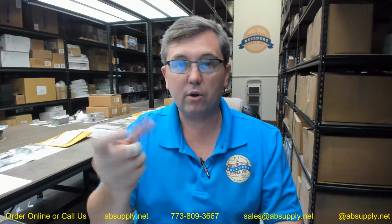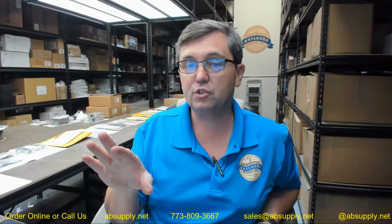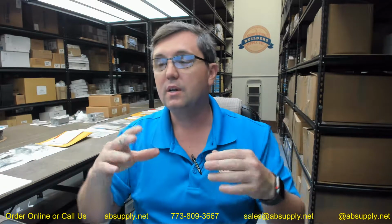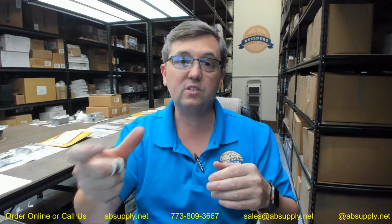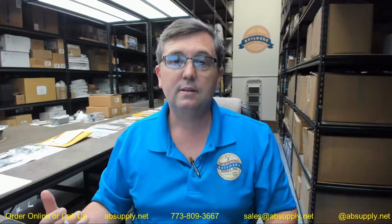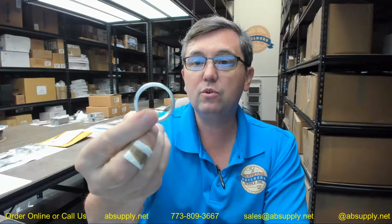The reason you're going to use a cylinder collar like this is because, well, you probably have a cylinder that's longer than necessary for the job, and it could be that the cylinder that you have that's too long is not available in a shorter length, like you would see in an interchangeable core type of application. You could have aluminum storefront sliding automatic doors with a hook bolt, and then you've got a 7-pin small format interchangeable core cylinder that might be about 1.5 inches. And you're going to need a cylinder collar. This may or may not be the right collar for that application, but nonetheless, that would be an example of where you'd use a cylinder collar.